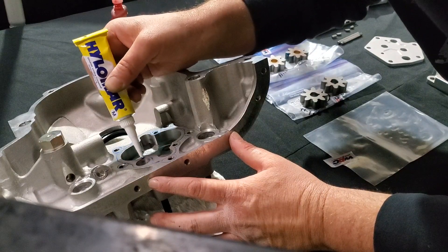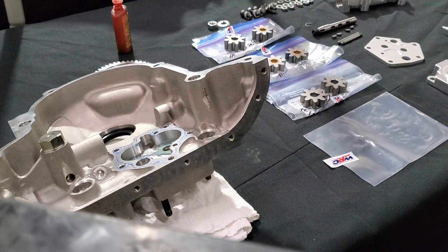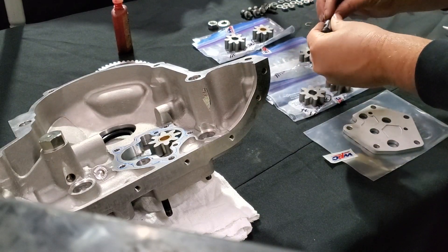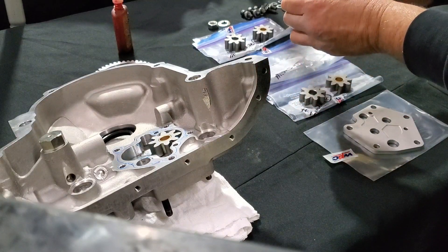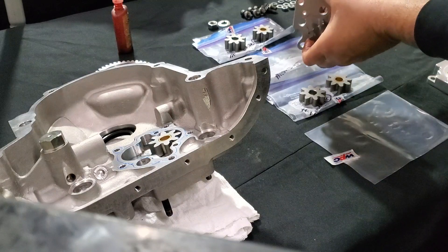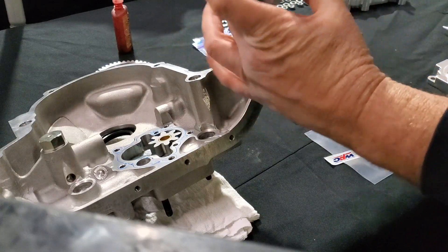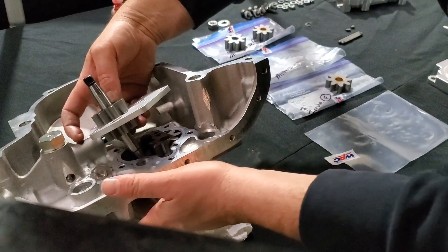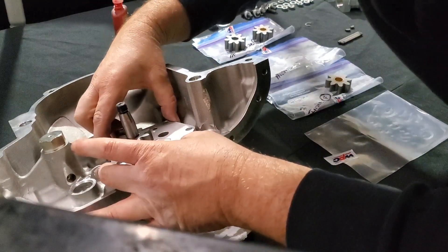We're just really picking up a tiny bit of the imperfections — not too much, very very minimal amount. So we've got our drive shaft keyway, middle gear already pre blue-lubed slightly, and then our floater plate, one more keyway, one more drive gear. You can see the nice stack — how that goes. This will drop down through, already lubed with Hylomar. Ideally drop them down in like that.